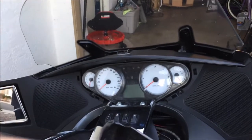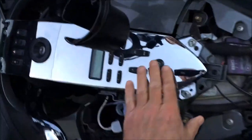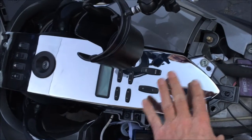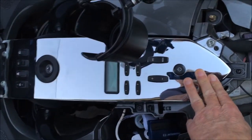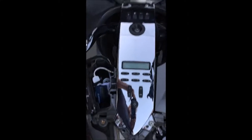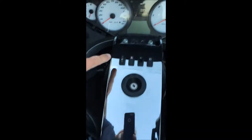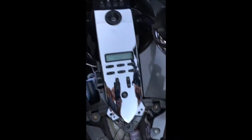With the bezel off and the cover in front of the seat removed, we're now going to pull off the radio panel. There are four bolts for the six millimeter metric Allen wrench. The four bolts are loosened — one, two, three, four. There's also one in the small compartment right here that also needs to be removed.